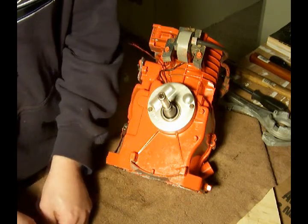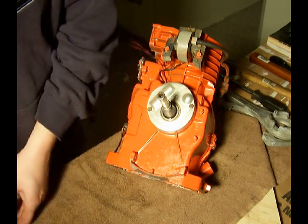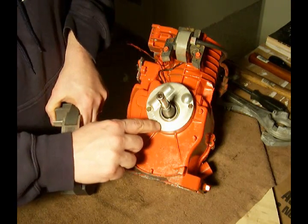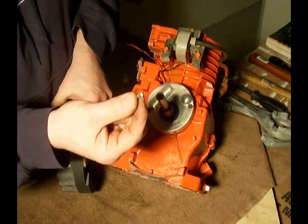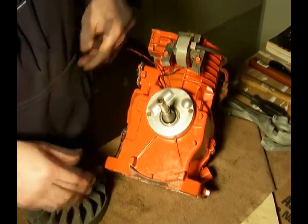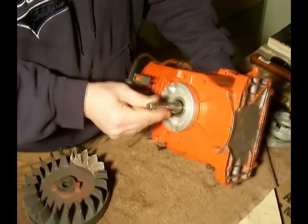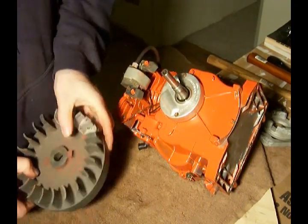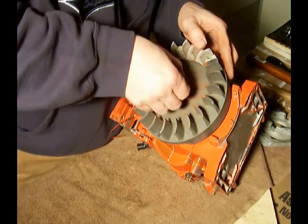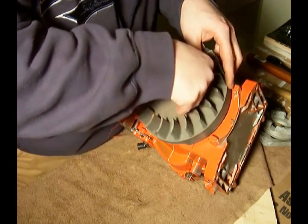The next step, with your coil raised up out of the way, we've got the flywheel, and this is the magnet on the flywheel. There's actually a note right here that says do not use a steel key for the flywheel. Here's the key we're going to use — you'll see that it does not stick to the magnet, so we know that it's not steel. What I want to do now is turn the keyway away from the coil, then set this in place with the key.